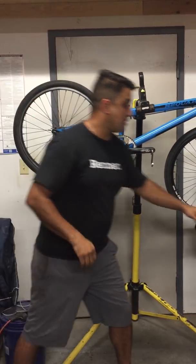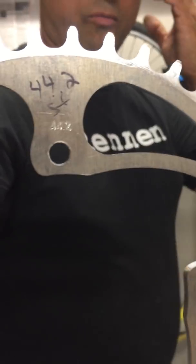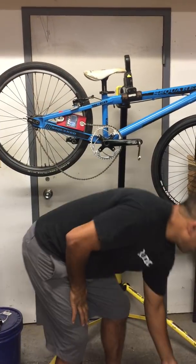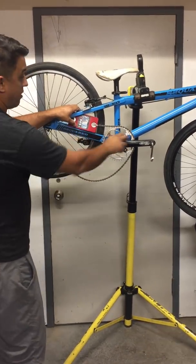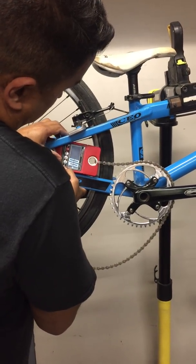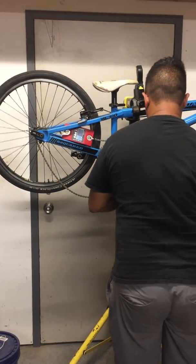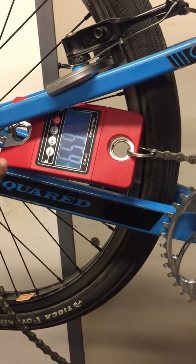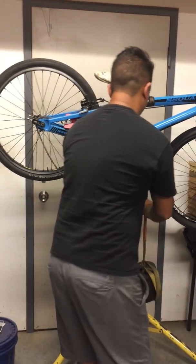Right now what's mounted on here is a 43.7. When I take that off I'll show you guys, but this is one straight off the machine — that's the 44.2. We're going to hang about thirty-four and a half pounds from the crank area and then measure and see what's happening. Right before I take this measurement I'm going to tare the scale to make sure we're working with a true zero. So now we're tared — we're going to hang our weight. That's showing 65.9. Remember that everyone: 65.9.